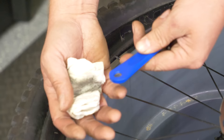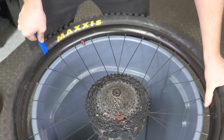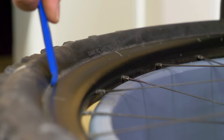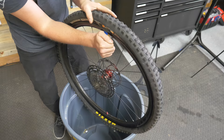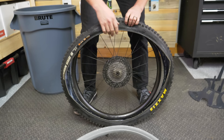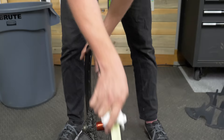I'm going to show you how to break that tire bead loose on the first side. You'll notice I have a rag protecting my hand. Make sure you use your tire lever and really push the tire underneath the insert. You'll also notice that with the tire lever, I have it turned away from the tape with the curve of the lever — that's to make sure I don't cut that tubeless tape. Next, we take that insert out of the tire, then the rest of the tire comes off. I want to wipe off all the sealant off the insert and off the inside of the rim.